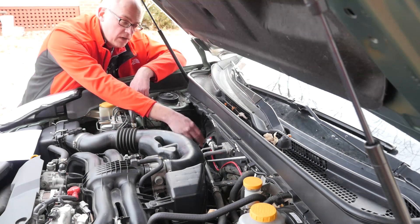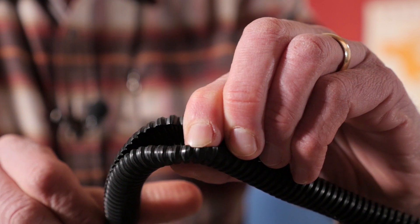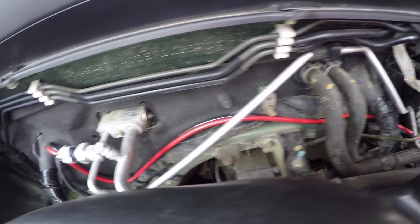I also had a couple of comments about the wiring in the engine compartment. First, it was mentioned that where I slit the grommet to get the power through the firewall, it should be weatherproofed — and I agree. As it gets warmer I'm going to put some silicone sealer in that spot to minimize water penetration. The second point is from Nick, who recommends getting some black split loom to put the power and ground wire in under the hood. It makes the wiring look much more factory, and adding zip ties every 12 to 18 inches helps too. Split loom is a flexible tube with a slit down the middle that you use as a channel to protect the wiring from abrasion. I left it off to illustrate the wiring path, but I'll most likely go back and redo the wiring with split loom for added protection.